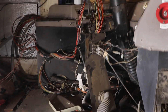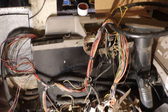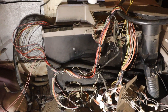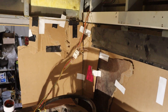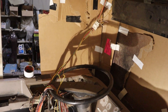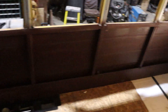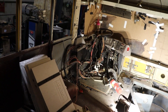I got most of the wiring harnesses out of here that were for the heaters and air conditioning system. All that's left is the lighting system, which is going to be a chore to weed out because they had a lighting control unit up there, with wiring running from the fuse panel up to it and then to the back of the bus. I'm probably just going to obsolete the whole harness and rerun my wires from the back of the bus, but I have to make sure there aren't any other functions hidden in that wiring loom.